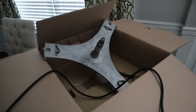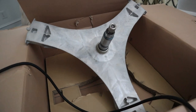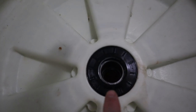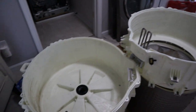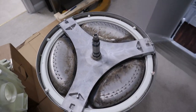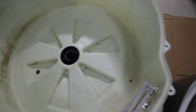About two days later I got the new and improved spider arm assembly and also a new tub gasket and rear main seal, which I've already put in. There is our new main seal for the rear of the tub. Time to start reassembling — new bolts, new Loctite, spider's installed. Now we're going to drop this into the shell and make sure it seats in the rear main seal.